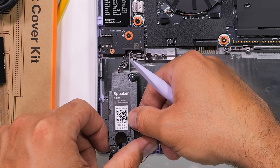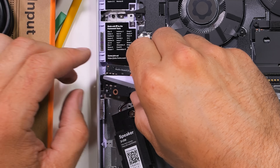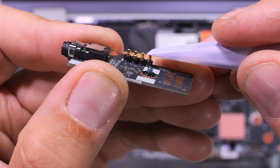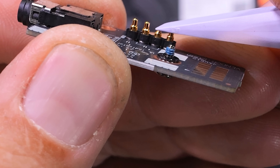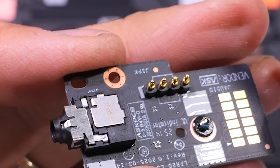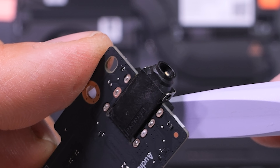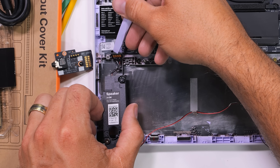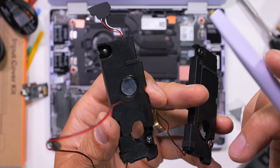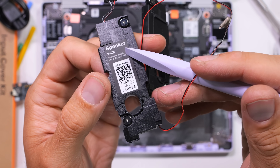The dual loudspeakers are modular — each is 2 watts — and both have the same style of captive screws, so there's nothing to keep organized. Both speakers are connected to the same audio board, which also contains the headphone jack. You'll see these springy pogo pins in a few places around the Framework 12. Instead of Lego-style or ribbon connectors, Framework is using these little springy pins to maintain contact with a pad on the opposite board — unless the laptop gets wet and the contact points oxidize, but you'll probably have bigger problems at that point anyway.